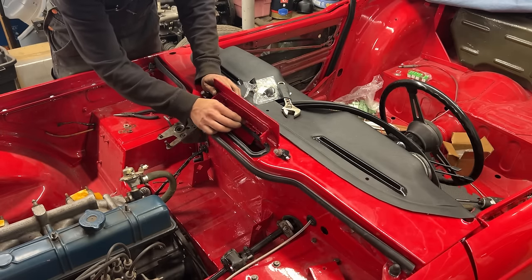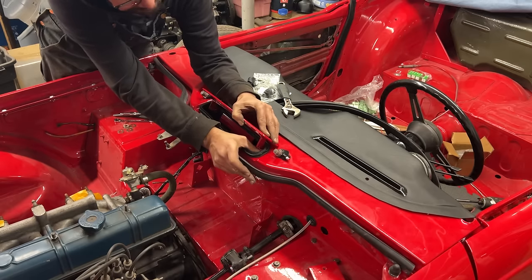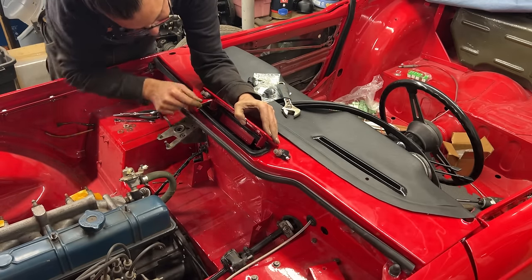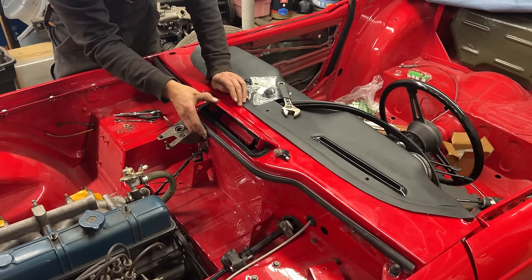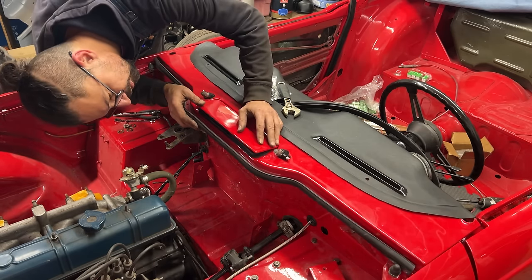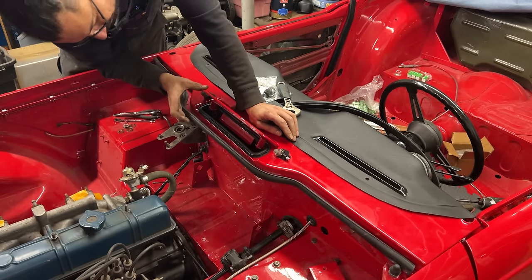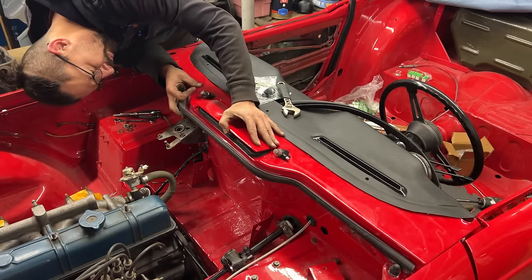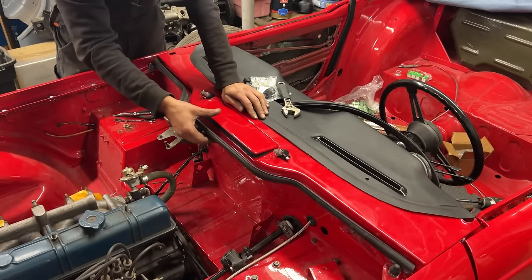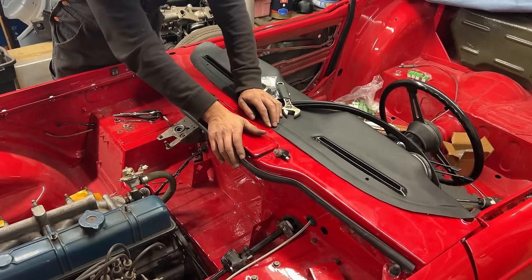The other wheel box is installed as well. Now we can put the seal — the three holes have to match these three holes, and there's a channel that fits over the lip that sticks up. We put the cover back on with an extra screw I found since there were only two originally, then reattach the springs on both sides. The rubber seal is a little bit too tall, but hopefully the spring tension will compress it down over time and make it fit.